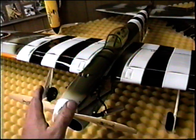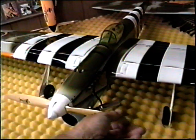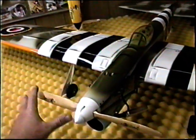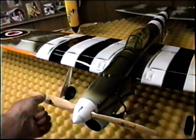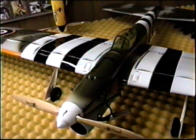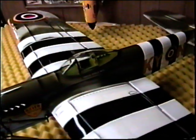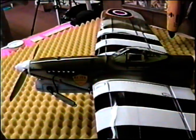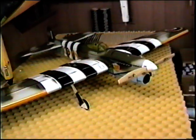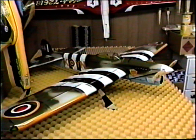The times we spent with four blades and three blades were nowhere near as good. I think the big gain was in having, first off, with the four strokes, they seem to respond to big wood props. They don't seem happy with carbon fiber for whatever reason, unless I just haven't hit on the right pitch yet. But again, we have Lyle Larson, who's good friends with the person who owns APC, and he's hopefully going to get the person to make a dedicated prop for us, which then, of course, we can pass on to the other people that want to try a 72 or a 91 Saito.